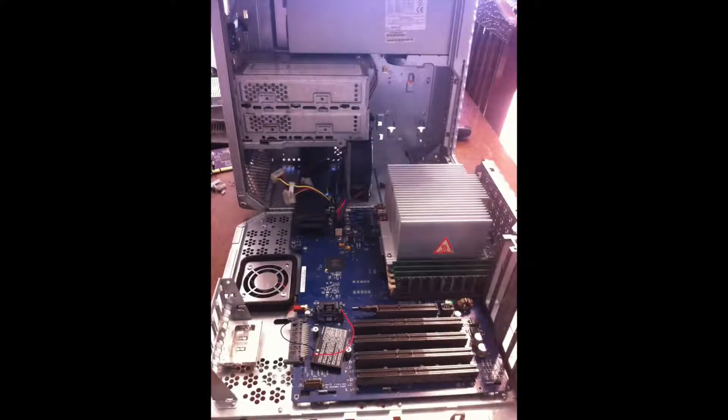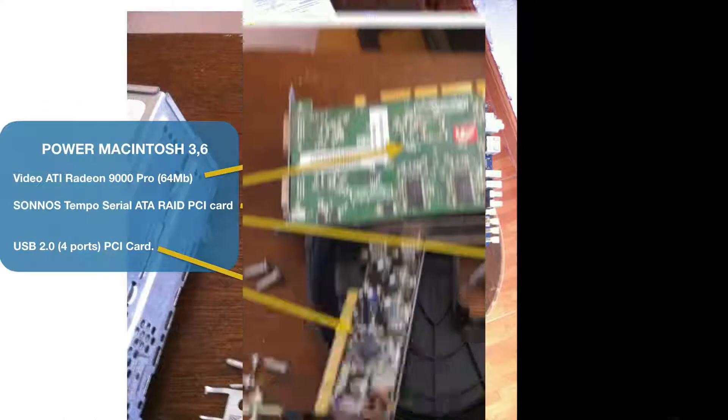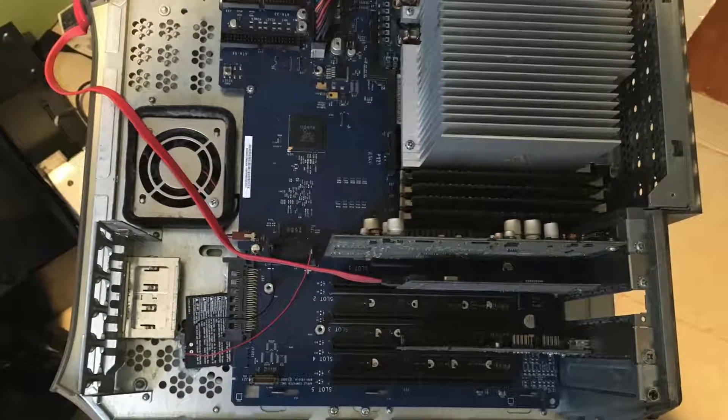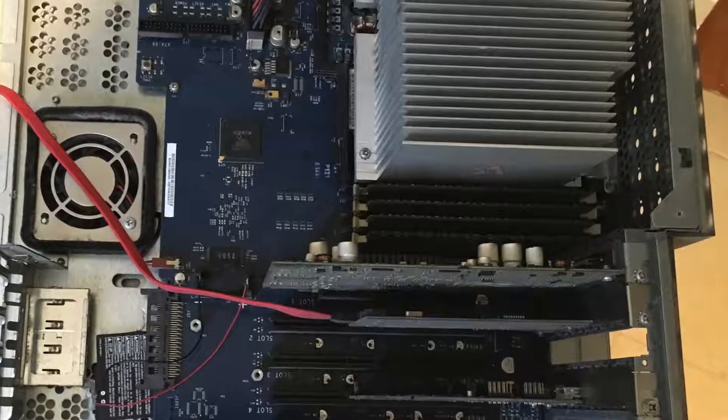A few years later I started to feel the computer was a little bit slow, so I decided to upgrade it with serial ATA drives. But this computer only had IDE — standard parallel ATA drives — so it didn't have any serial ATA ports. I added a Sonnet Tempo SATA card with two serial ATA ports for two drives, supporting RAID 0 and RAID 1. I also added a USB 2.0 card to speed up the USB, since the original ports were only 12 megabit USB 1.1.